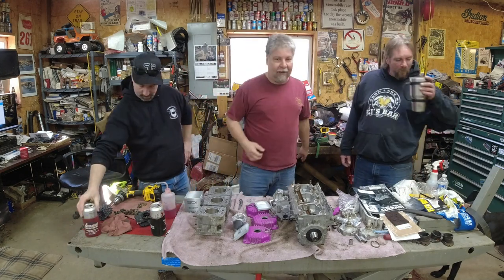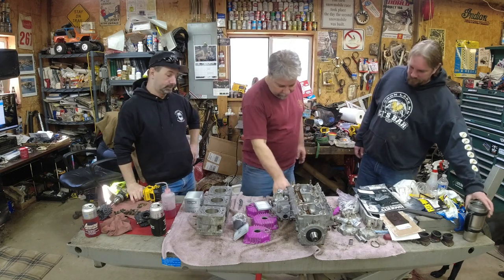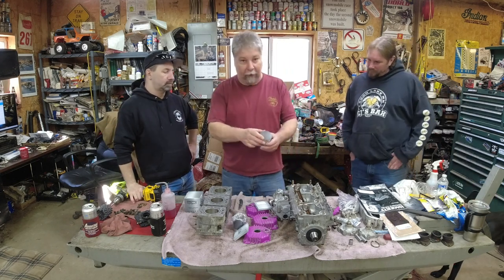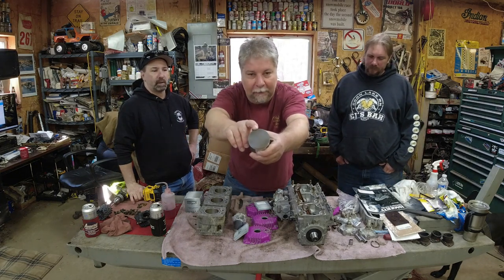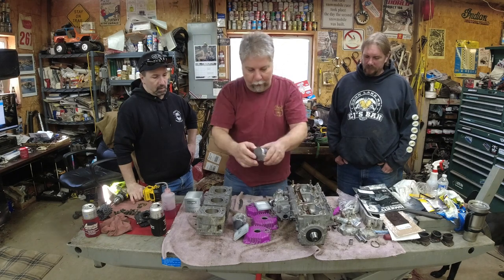So, next thing we got to do is get the pistons on. And let's talk about that for a second. You can see on the top of the piston there's an arrow. On a Polaris, that typically points to the mag side. But if you want to confirm it,